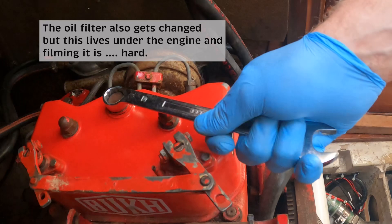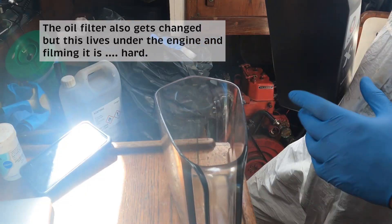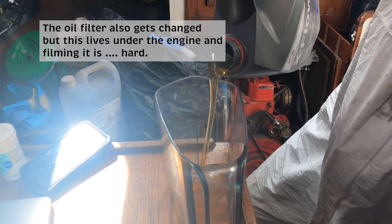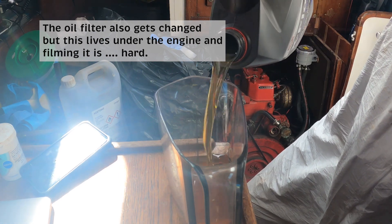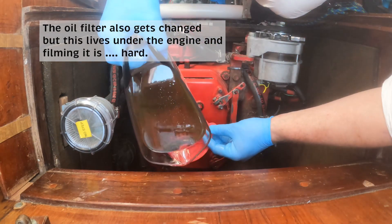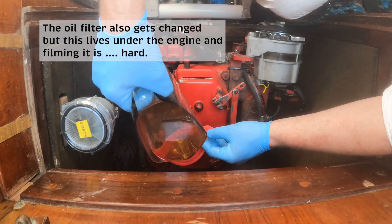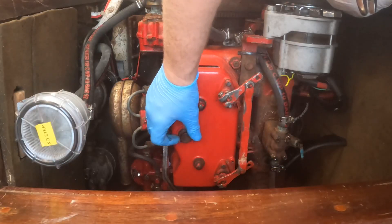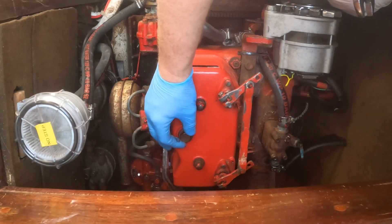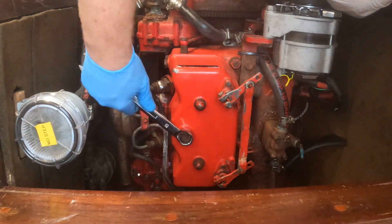There might be a few hundred mils in the system going into the filter, so it's really quite a good change. On this engine, to put new oil in, you just open up a nut on the top of the valve case and pour it in — in my case from a measuring jug that I normally use for measuring water for cooking, so that has had a very good clean. It is a bit disgusting to have done that, I recognise, but it is clean oil, and then you just do the nut back up, measure the levels, if they're okay check them again in a bit, and off you go.